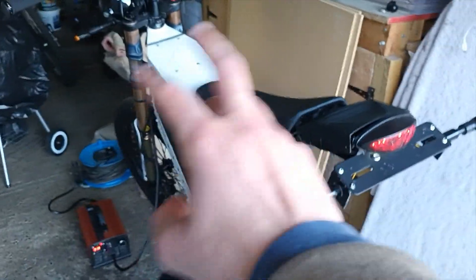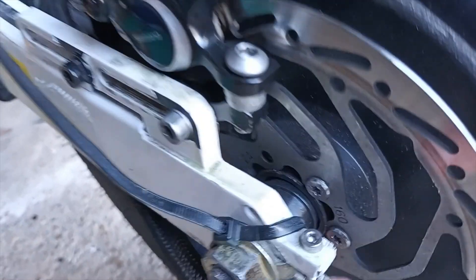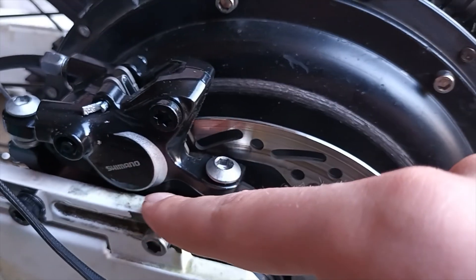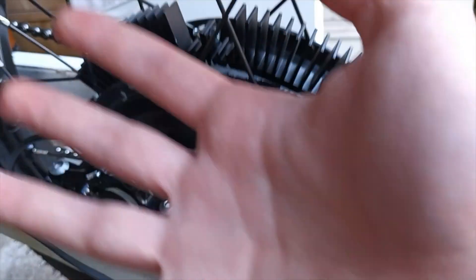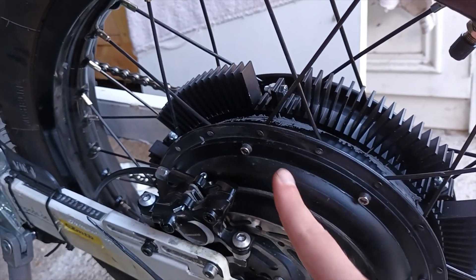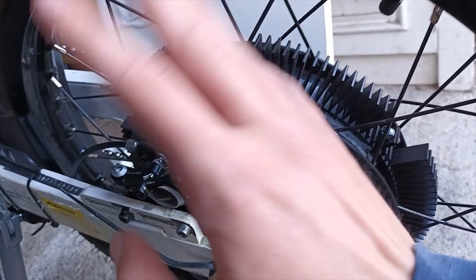I've just been out on the bike and noticed down on the back caliper there is oil everywhere. I think what's happened is I haven't tightened up the bleed screw properly and it's been leaking out and dripping onto the rotor, because the back brake didn't really do anything — it was firm but it just didn't really slow down. So when I do the new brakes I'll at least need to clean the rotor, if not get a new rotor and new pads. Bad on my part.